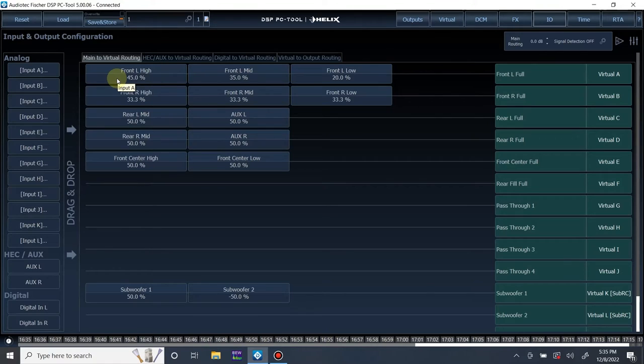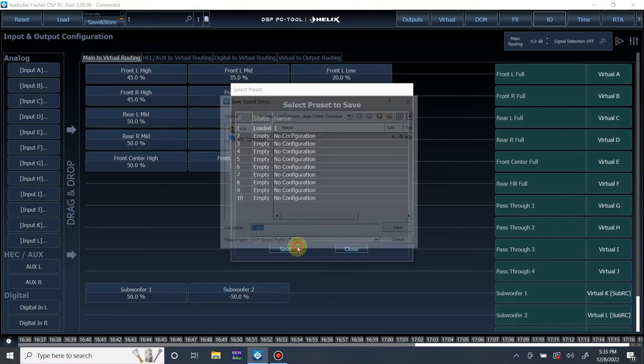So moving on, let's just do the same with this. I don't even need to transfer this. I can just copy it since we know left and right is the same. And we already applied our EQ since the sides were paired. And that's pretty much it. I already know we don't need to do EQ to the subwoofer, since I already measured it before this video. So that is pretty much it for our input gains, our input EQ, our summing, everything like that. So I'm going to go ahead and save this.